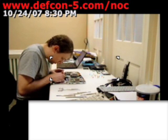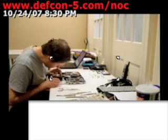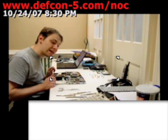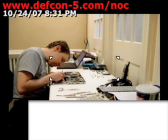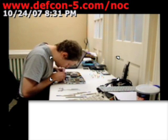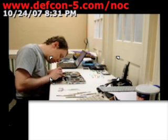There we go. I had to use my fingernails. That was probably power for the thing, the trackpad. This is another zero insertion force connector. Looks like this one flips up. Nope, I stand corrected. This one slides out. Use my fingernails on this one because there's so much stuff around it. I can use my dental pick and kind of just slide it out and up.